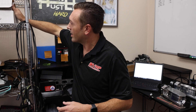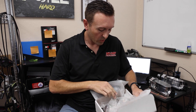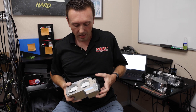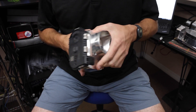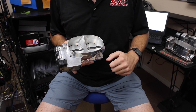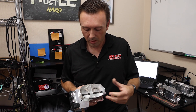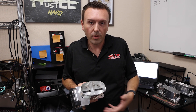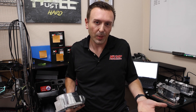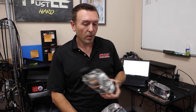Another nuance: in 2015 Ford introduced new electronics — you can see from the motor cavity that it's much larger than the older ones. These electronics are better at breaking the vacuum and cracking open the blade, so this is one scenario where you can get away with a mono blade in an application that maybe otherwise shouldn't have one, if you're using the 2015-and-up electronics.